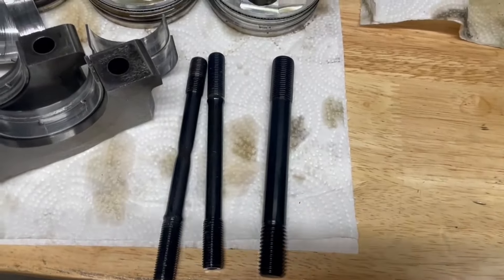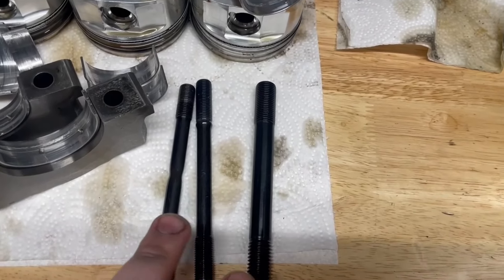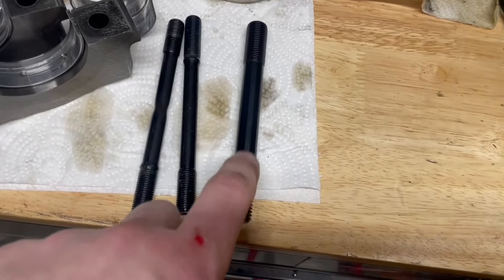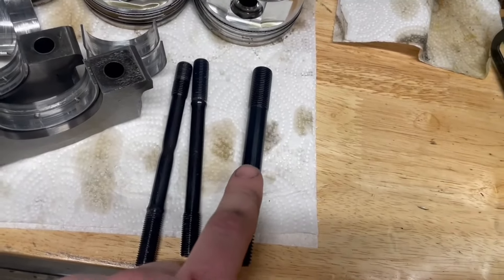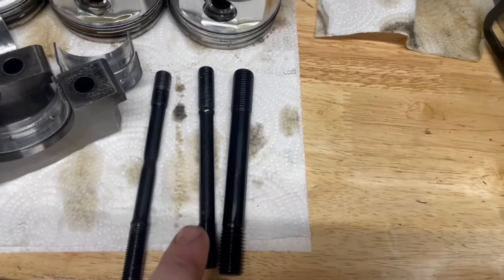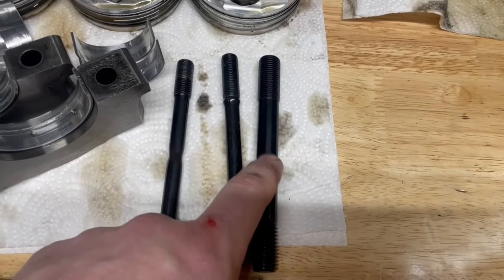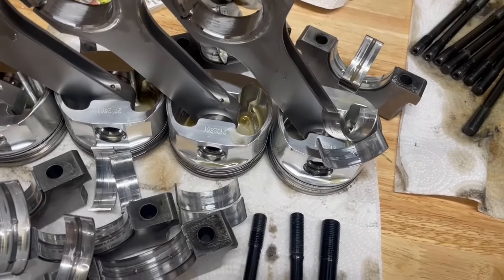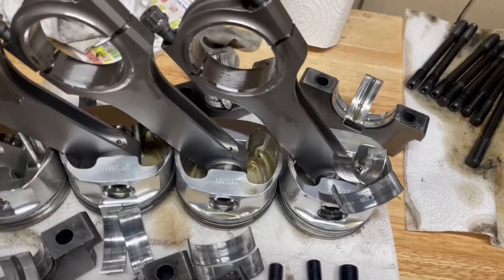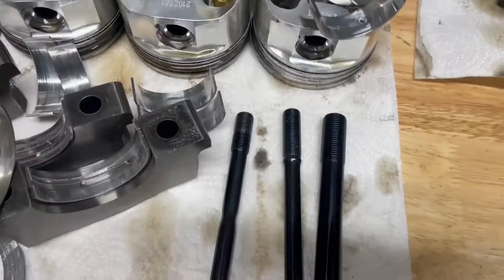The new studs are really thick and obviously won't fit stock, so we already sent a spare block and a spare junk head down to the machine shop. They drilled and tapped the block, the head, and the head gasket all to take this larger stud — to verify that we're going to be able to make it work, and we are. This right here is twice the size of the original as far as cross-sectional area, same material. We're going to assume this will hold twice as much torque or pressure load, which means this should handle more than what we can get out of this engine. We're still on steel rods — anything up past 700 horsepower, steel rods can get a bit sketchy, but these rods are massive so we might be able to push to 800 or even 900. This will outlast that for sure.